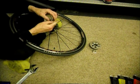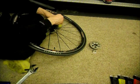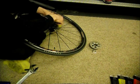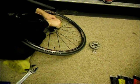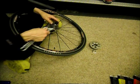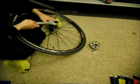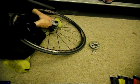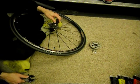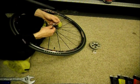Then I take the lock ring, just put that in there, and I can just turn it in by hand. And then from here, I don't need the chain whip tool, so I can just go ahead and just turn it, snug it up. I don't have to really crank on it at all. I should use a torque wrench, but I usually don't. Just pop that off, and then all I have to do is put the skewer back on, and I'm done.